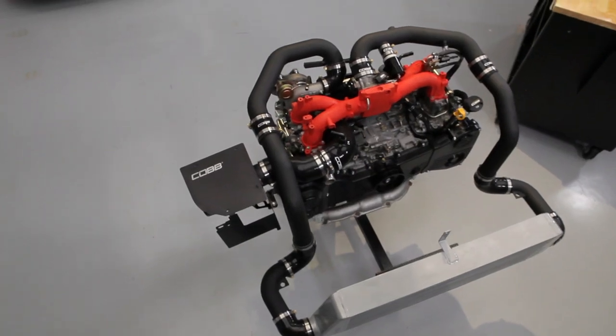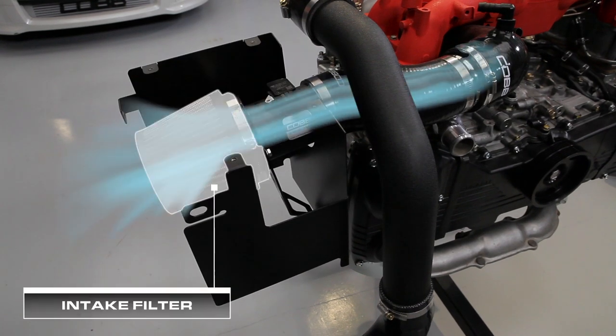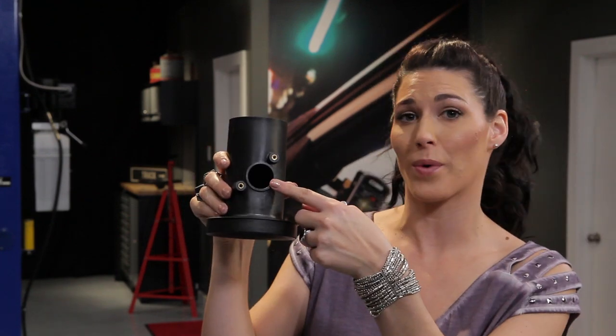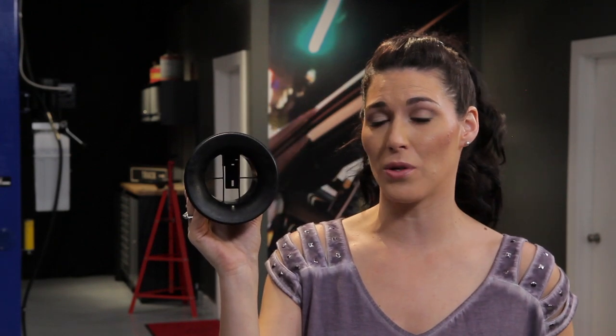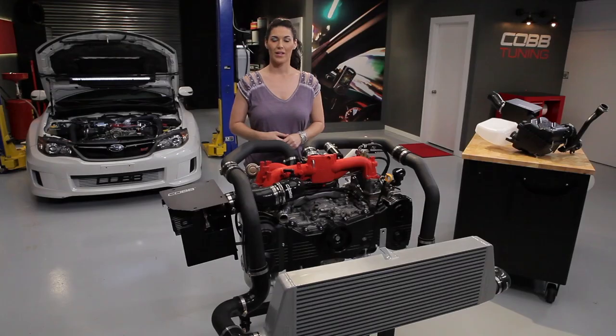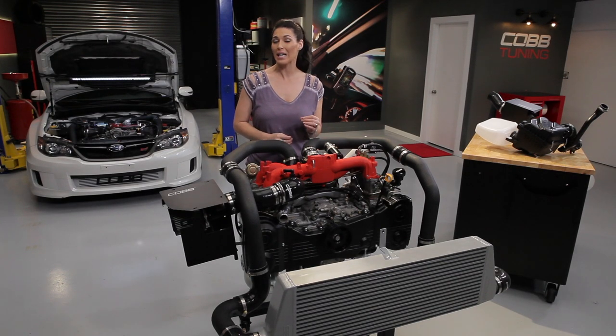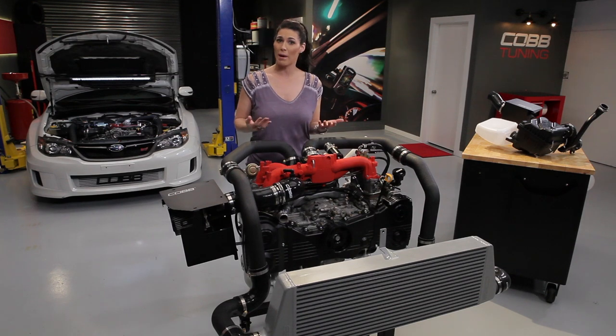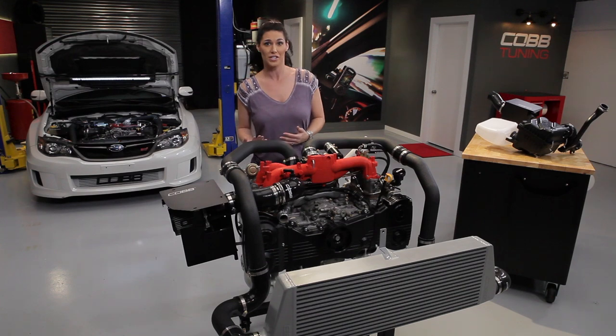Now that we know how an upgraded air intake goes together, how does it all work? First, air enters through the filter and into the MAF housing to be read by the MAF sensor. The MAF housing is designed to control airflow with straighteners as it enters the intake and passes through the sensor. We want the sensor to get the most accurate and consistent readings. MAF stands for mass airflow — this sensor measures the amount of air flowing past it, as well as the temperature, in order to adapt to various climates. This reading provided to the ECU dictates vital functions like fuel needed for complete combustion, load calculation, ignition timing, and other key factors.